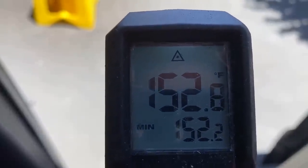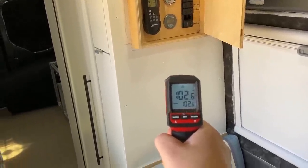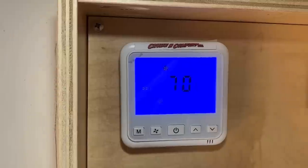We're back in the van and it is a pretty hot day today — a good day to test this air conditioner and see how effective it is. The weather report says 85 degrees outside. The tarmac reads 152 degrees with the thermal gun, shade on tarmac about 100, the white wall of the van is 100 degrees, and the floor is about 96. It does not feel comfortable in here at all right now — I feel like a hot dog left in a car. The air conditioner is kicking up. We'll set it to 70 degrees. Standing next to the cabinet with the evaporator and compressor, with the fan on maximum speed, it is pretty loud — you have to talk louder than normal to be heard.